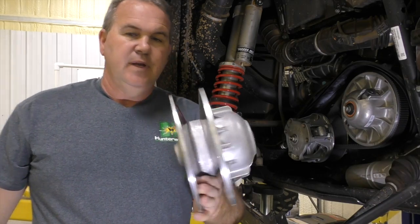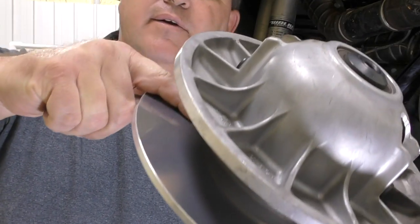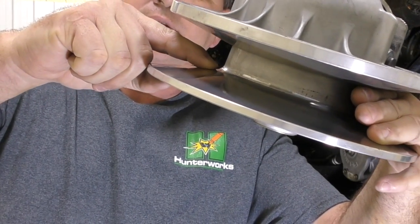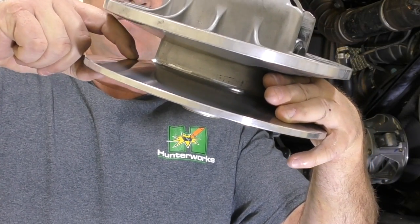What we wanted to do is limit that travel by limiting it at the primary, which limits the belt travel and stops it at a safe point. There's a speed-limiting spacer — when it's correct, it stops the belt right where the flat portion is. They were going too far, and all we're doing is backing it up to where it runs to the maximum safe level.